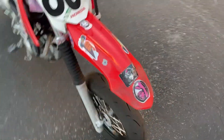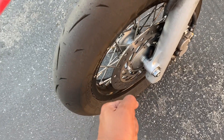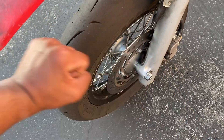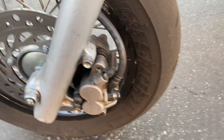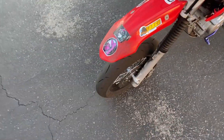The only two issues I've had with these rims: anytime you want to take the front wheel off you have to take the rotor off first, then loosen everything up and pull the axle all the way out before removing the wheel. Otherwise if you just try to slide the bolt out, this joint gets stuck in the rim right there — the rotor has no room to slide past. So every time you change tires on the front, you've got to remove the rotor too, but it's just four screws so it's no big deal.